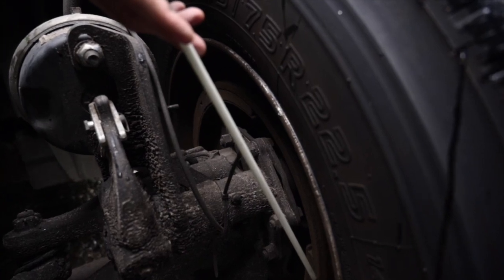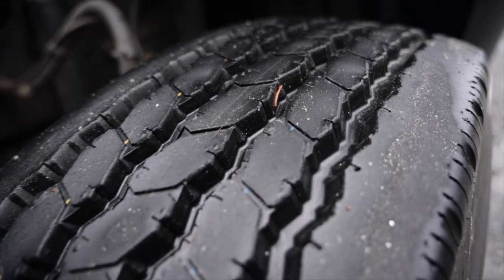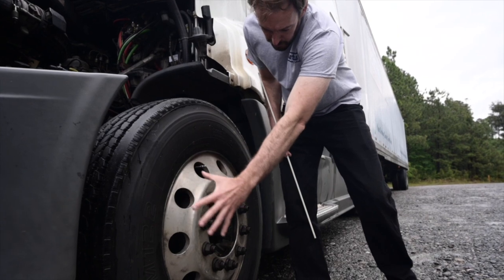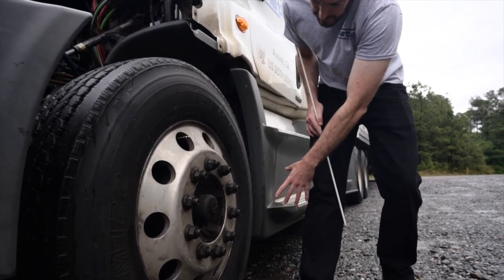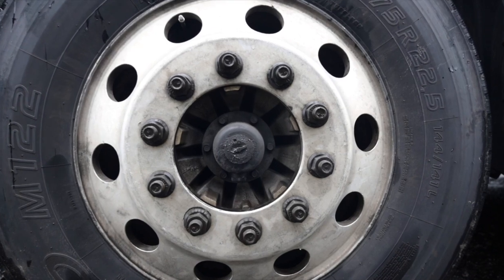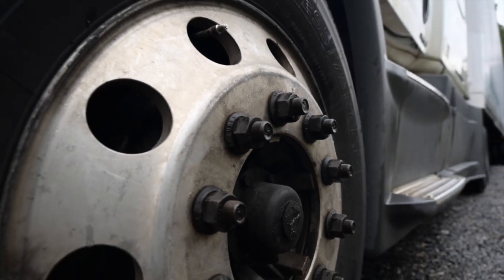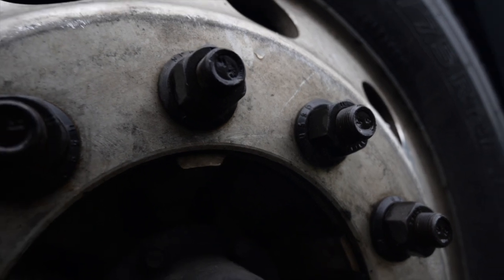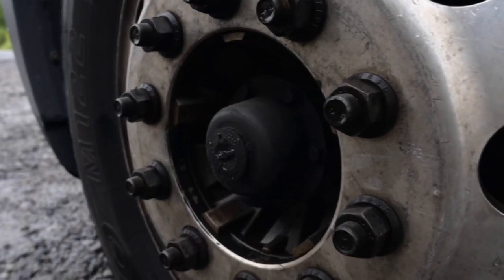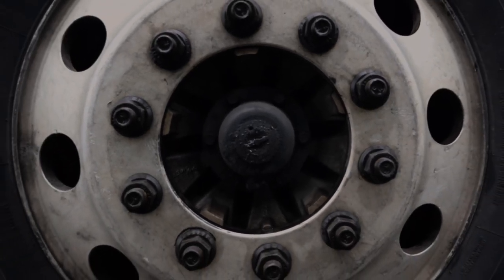There is no debris, oil or grease inside the shoe. Steer wheel group. Front tire: the tire tread must have 4/32nds of an inch or more of tread depth in all grooves. The tread is evenly worn with no abrasions, bulges, cuts or other damage to the tread or sidewalls. The tire must be beaded properly to the rim with no leaks around the rim, and I would check the tire pressure with a tire pressure gauge at the valve stem. The valve stem and valve cap are not missing, broken or damaged and are not leaking. Rims: not damaged, not cracked, bent or broken, have no unauthorized welds and are securely mounted. Lug nuts: securely mounted, not cracked and none missing. There are no rust trails or shiny threads that would indicate looseness or cross threading. The bolt holes are not cracked or distorted. Hub oil seal: securely mounted, not cracked, bent, broken or damaged, no missing hardware, not leaking, and the oil level is correct. I would check this visually with the sight glass or remove the plug and check with my finger.